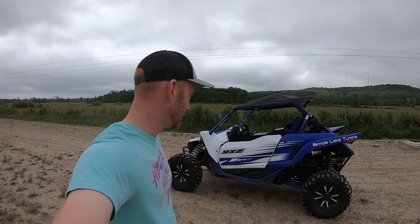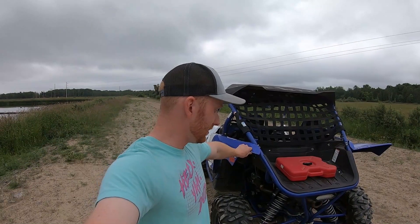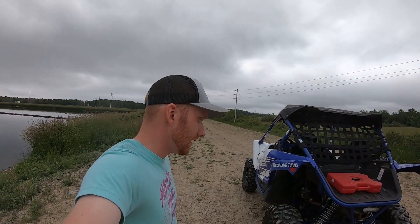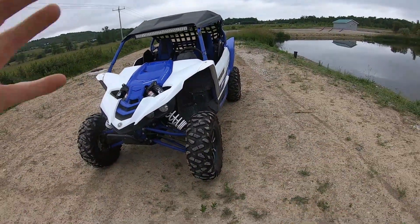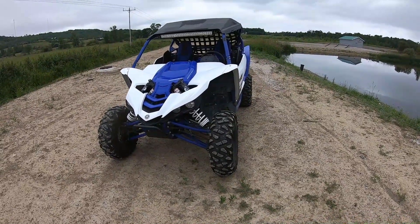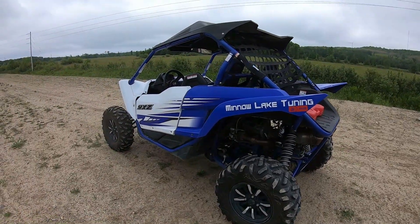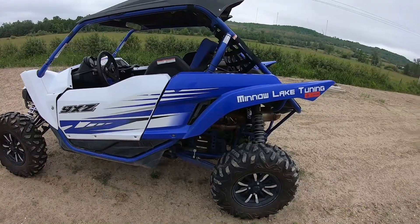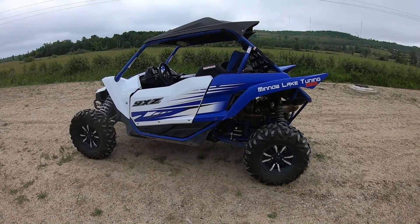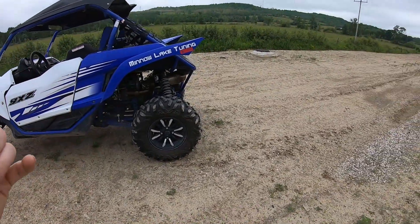Quick rundown: I ran it last season at five pounds, all stock motor. It does make a big difference power-wise - it's a lot over stock. At five pounds it'll put you at about 150 horsepower. But you really have to consider your options, because you could almost get that naturally aspirated with an exhaust, tune, cams, and an airbox spacer. You can get close to 140-150 horsepower NA, and that's a more reliable setup because these motors like to throw rods with boost.